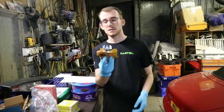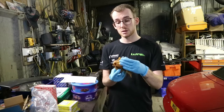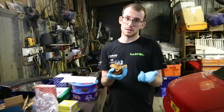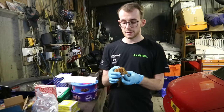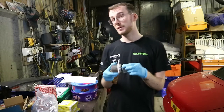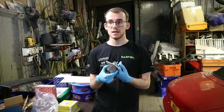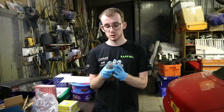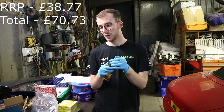So this is the water pump. The problem is these fins corrode over time because they are galvanised steel — with water, coolant or anything like that they will degrade. Some were also plastic and they can snap off, which you obviously don't want going into your engine. Even though it wouldn't cause harm, it would clog something up. So it's a nice remanufactured part.